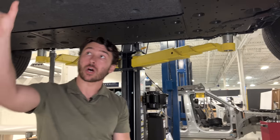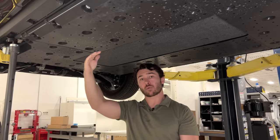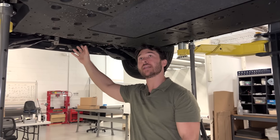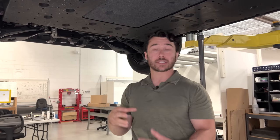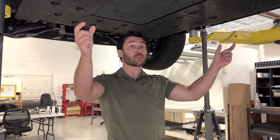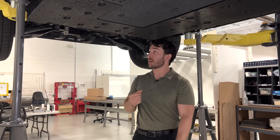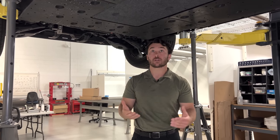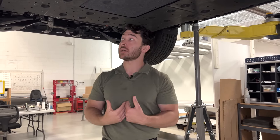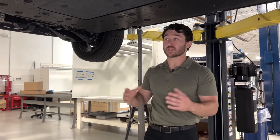When that pack was dropped along the side sill, we were carrying coolant lines external to the pack that were not for thermal management of the pack, but actually delivering glycol to the rear drive unit where we had the oil glycol heat exchanger. In this, rather than using a separate component, which is that nylon coolant line, we're using part of the profile of these extrusions to carry that coolant out to the rear drive unit. So rather than having a separate component, they're just carrying it in an existing structure, which is exactly the kind of thing that we want to see and that we've suggested to clients through various workshops for cost optimization, as well as overall part reduction.